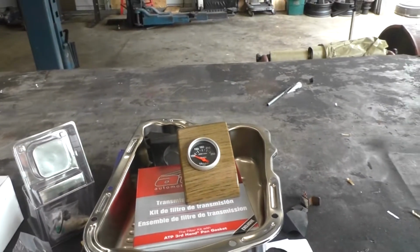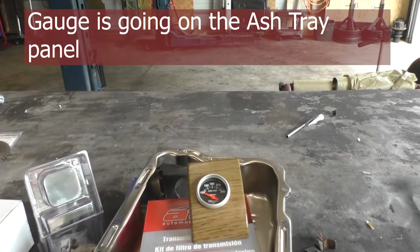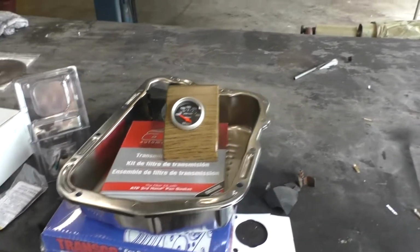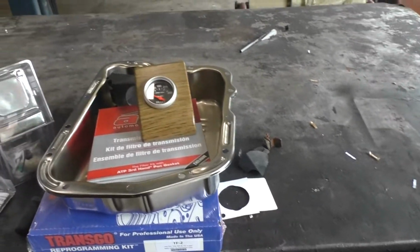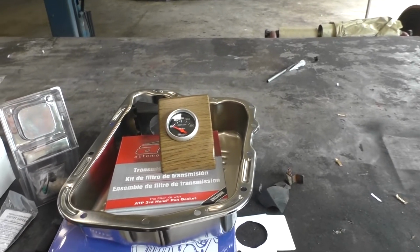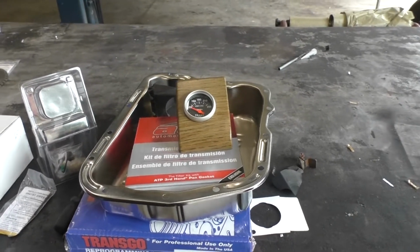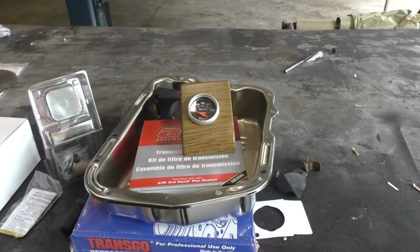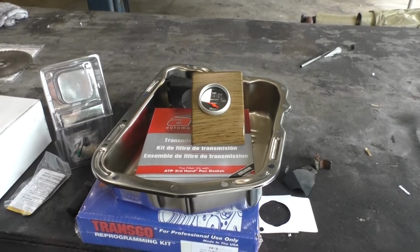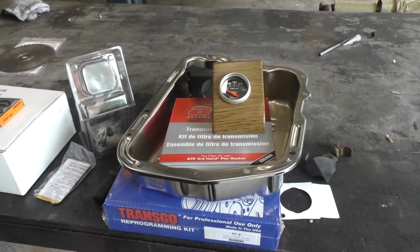I bypass all of my automatic transmission systems that go through the engine radiator. I think that's a bad idea. I mean, hydraulics like to run 150, 160, 180 degrees, and an engine wants to run at close to 200, and a transmission will start to fail over 220. So why introduce all that heat? So I always bypass mine, and I've got an auxiliary cooler on mine, on actually all my older vehicles and even the newer ones, and it's much superior, much better, easily controlled temperatures, etc.